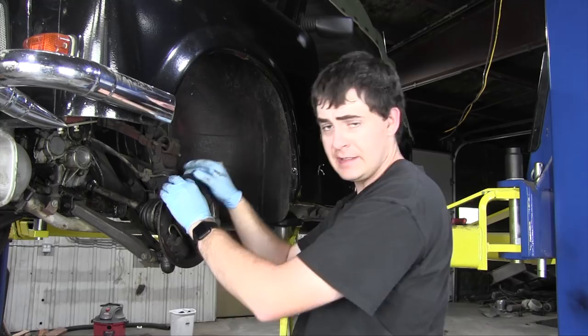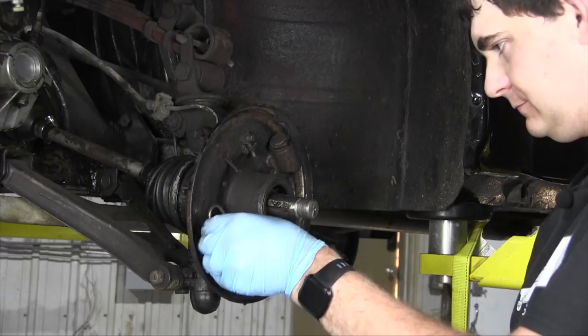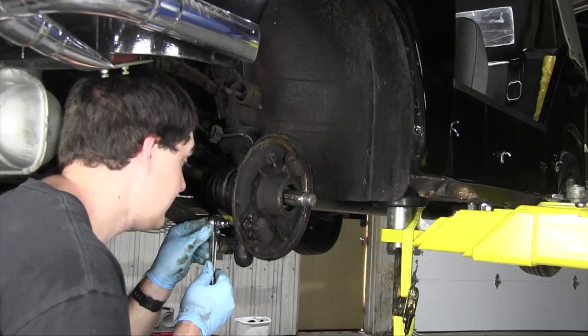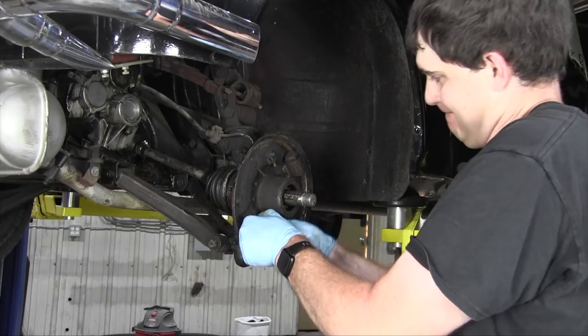In case you're wondering, Trabant brake drums are self-adjusting, so you don't have to do any manual adjustment, which is nice. Time to loosen the brake lines, one cylinder at a time. Each wheel cylinder is held on by two socket cap screws from the back. And wheel cylinder number one is, well, it's still on there quite well. There we go. Comes off.